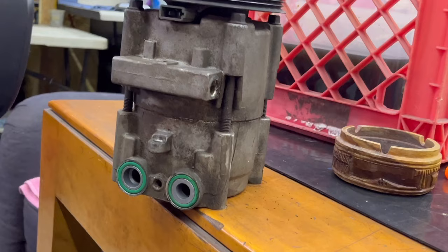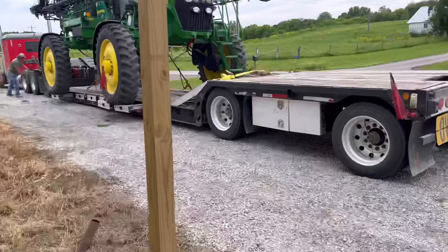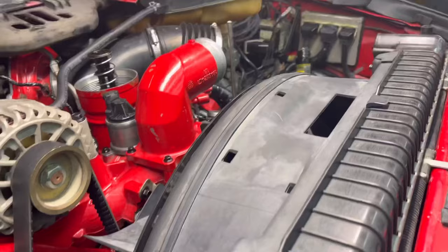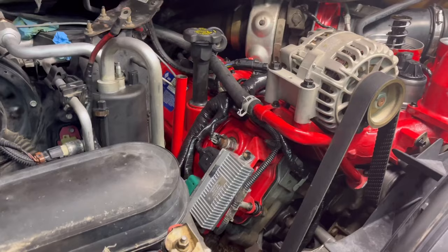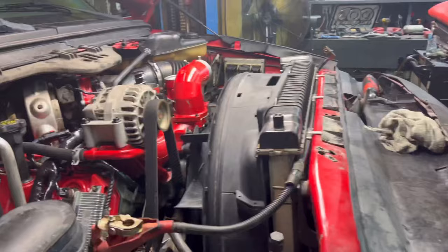I think that's a problem right there — you should have stuff come out of here. The farm got a new spreader. Been putting stuff back together. It held vacuum — we held it for a good while. It must have just been that compressor, or one of the o-rings wasn't right. We replaced all the o-rings, orifice tube, dryer, flushed out the condenser and the evaporator core, new compressor, new oil cooler. We put a used number two injector in because it actually fired pretty good — it did not fire that bad.